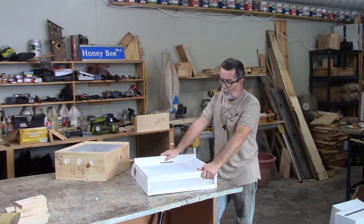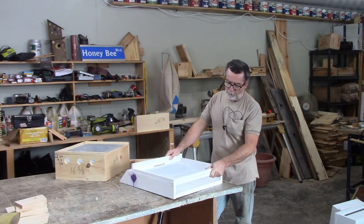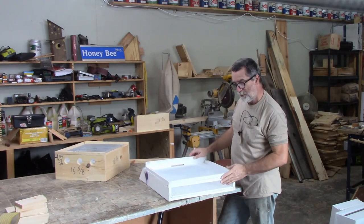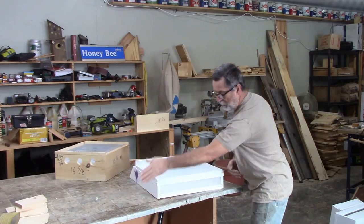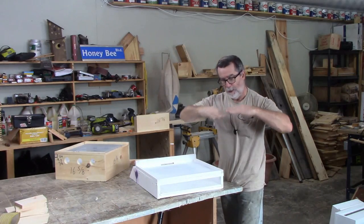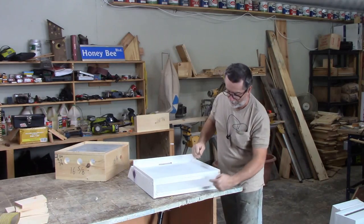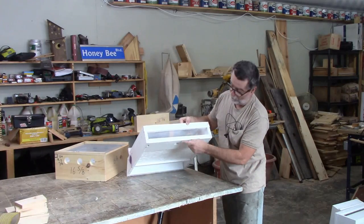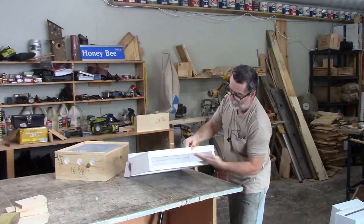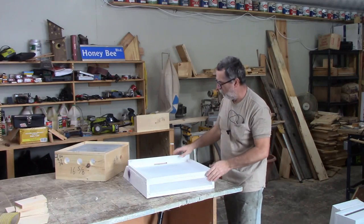Hello, Scotty here. Today I'm going to try and make a few improvements on the floor that I have. Overall I do like this floor, but it has a couple things I want to improve. One main issue is when it sits on a pallet, you've got that central 2x4 and the 2x4s on each side — usually fairly thin lumber. So the load is on those boards, and when stacked up it's pretty heavy, and with moisture and time it wants to sag. That center 2x4 presses up, and all I have is half-inch plywood and a piece of half-inch pine six inches wide on its flat — not very stable. So this tends to crown upward, making it difficult to get the door in and out in the back. I want to make it a little more rigid.